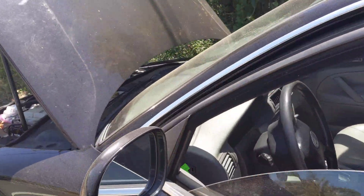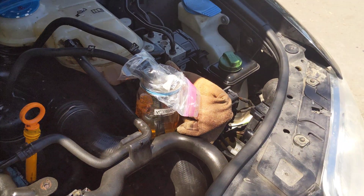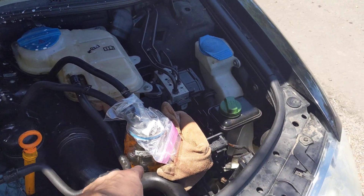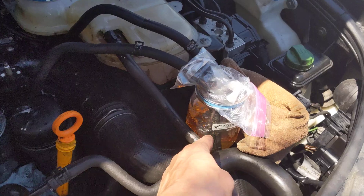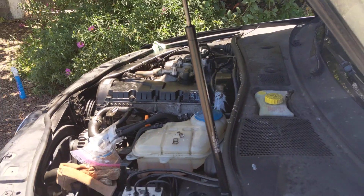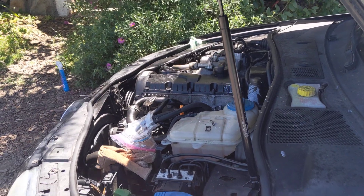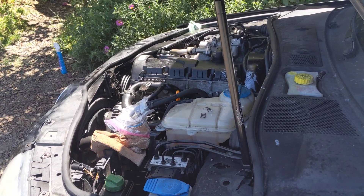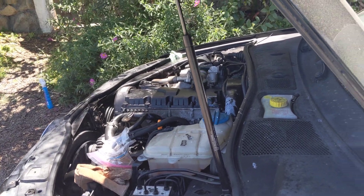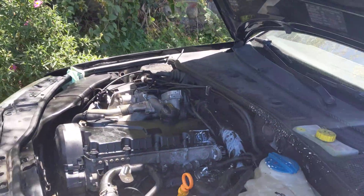I just pulled the fuse, took those lines off, put the other lines in the jar, replaced the filter, and now we're just running this for a while. They say it might be best to use a filter on this, and I totally agree. If you do it, do it this way where you put the lines in the jar. Make sure you clean those lines really nice and good — you don't want to get any debris in your injectors. The whole goal of this is to clean your injectors, so make sure if you do it like this that it's totally clean, including your jar. Make sure there's nothing in there — no dust. Wipe it out or even wash it beforehand with some stainless steel wool, then dry it out.